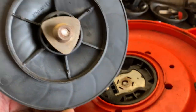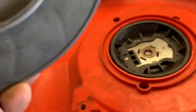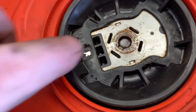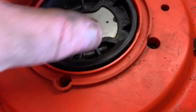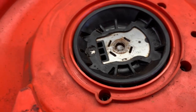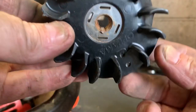Oh no no no no — we've got a broken crank! My goodness, that's not good. Is the flywheel loose? I bet it is. You know what, when this thing over-sped I bet that flywheel key is also sheared. Yep, absolutely it is. My goodness.